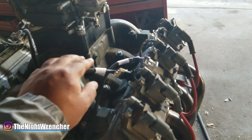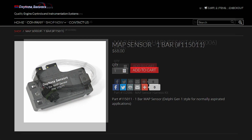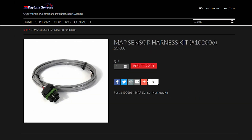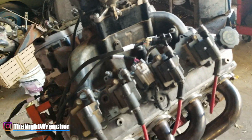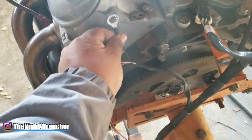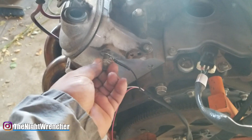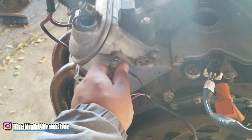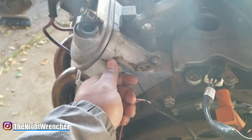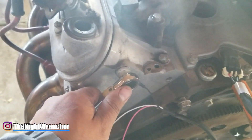You can also buy a race-style MAP sensor directly off the Daytona Sensors website. They offer 1-bar, 2-bar, and 3-bar sensors depending on how much boost you're running. If you're naturally aspirated, a 1-bar is more than enough, but I like to get a 2-bar just in case. Now that all the electrical connections are plugged in, we'll set up the ground. I like to ground right here on the cylinder head — it's a pretty standard metric size. Make sure the threads are clean, because if you don't have a good ground your box isn't going to work correctly. This box has a single ground point, which they engineered that way, so I wouldn't be too worried about it.